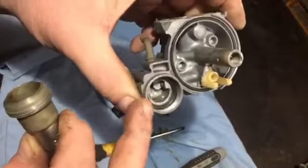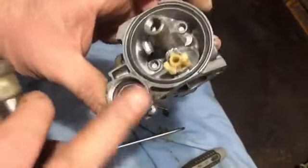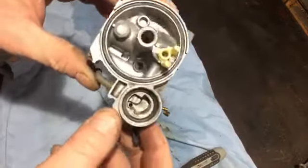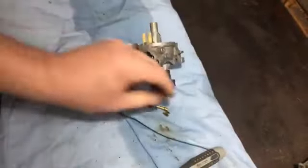Pretty clean in there. And there is a rubber ring in there as well. If that comes out easy, I should take it out. But if not, just leave it in there and just give that a little carb spray. I think my socket's stuck on at the moment, but I can leave it on top of this bit and put it back on. So I'm going to carb spray it all down for all the holes, and then give it a good blow off, and then clean up all these little bits.